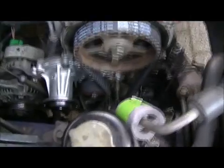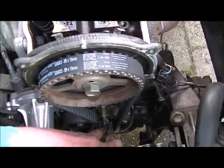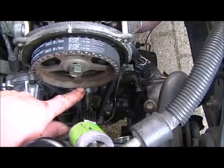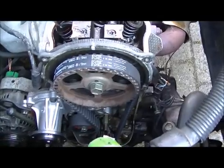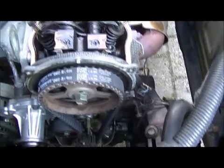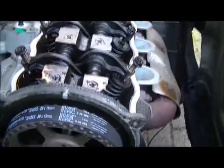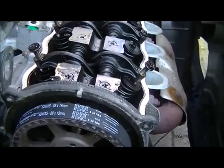Of course. The Suzuki manual specifies that I have to align the crankshaft pulley with a timing mark, and that I have to align the camshaft pulley with a mark. Of course I rotated the camshaft, having installed the belt twice, and after that I could fix the tensioner in its place. So now I am working on the valve adjustments, and it turns out, well, it's quite easy.